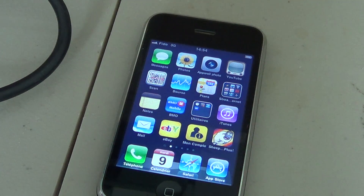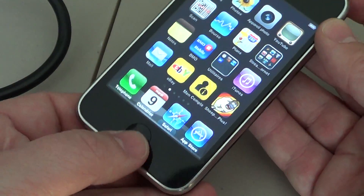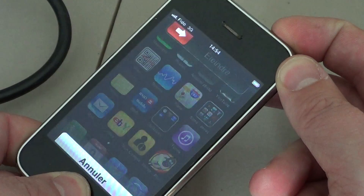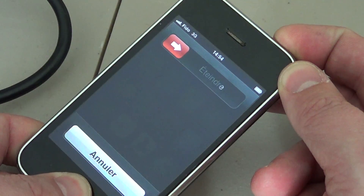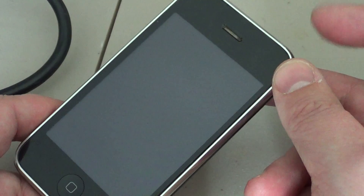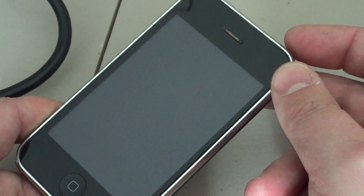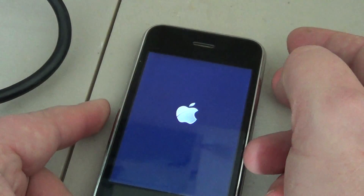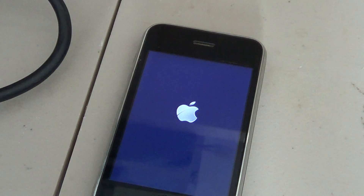You really want to have a clean startup. How do you do that? You just hold the button at the bottom and the button at the top, and don't mind what it says on the screen. You're going to see it shut off — here we go, it shut off by itself. That means you really shut it off. So you just press the power button once to start it again and wait for the screen to come back to the regular Apple iOS start screen with your icons.